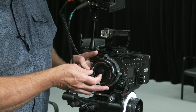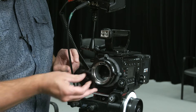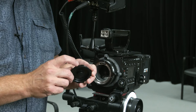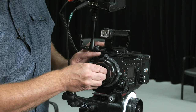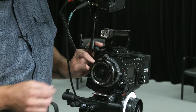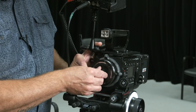The PL mount is about an eighth to quarter turn to the left and the cap will come out of place. There is a keyway right at the top at about the two o'clock position — that's what I'm matching up. The lens has those, and so does the cap. A nice quarter turn clockwise and that's tightened into place — positive lock.